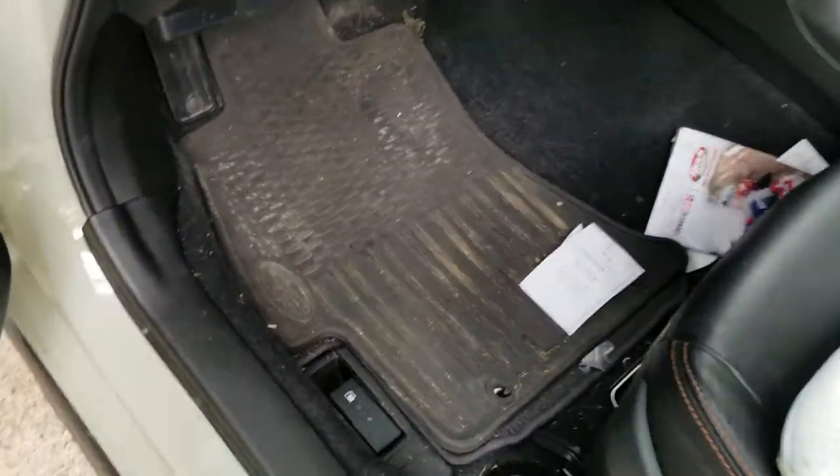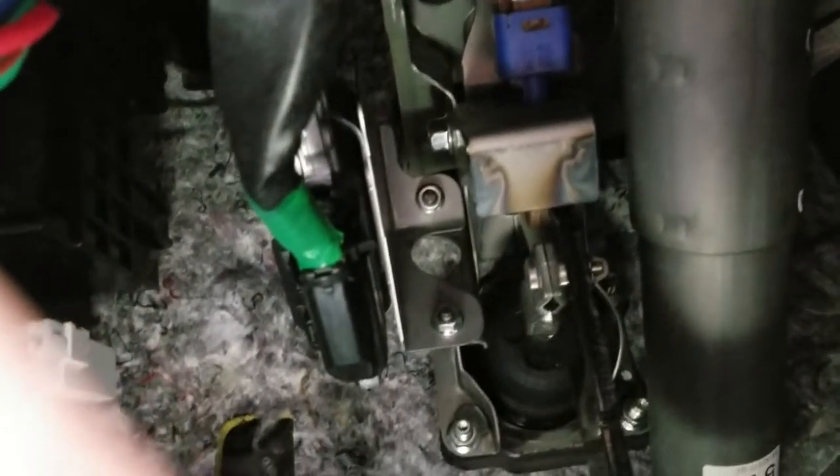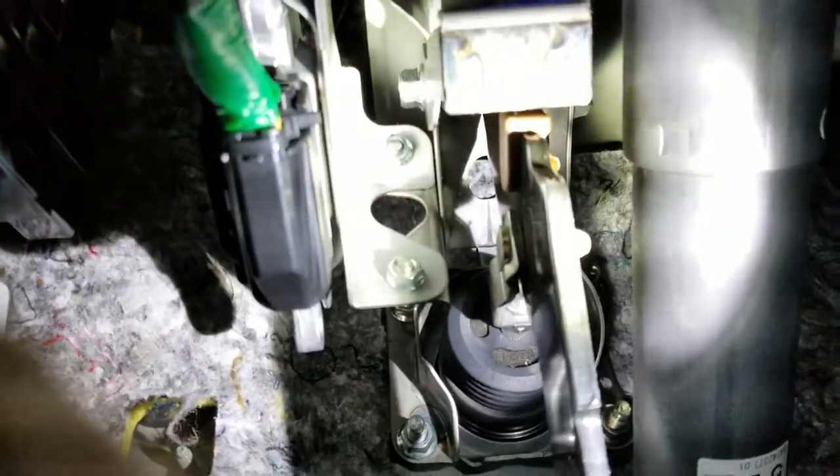You can use a back light — you don't have to, but it helps. Okay, so this is your brake pedal, and if you follow it all the way up you'll see the brake light switch. In front of that brake light switch is the bushing. This one is brown and has a different design than what you normally see — I actually never seen this design before, so I learned something new today. I'll show you on my truck to show you how you normally find them.